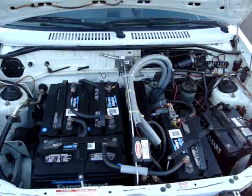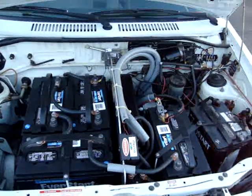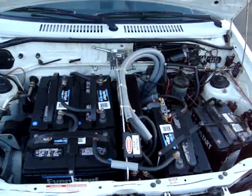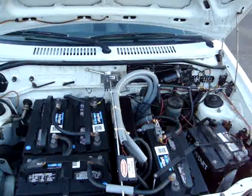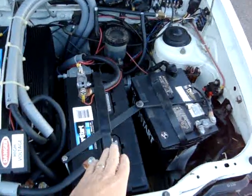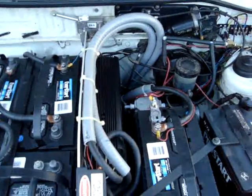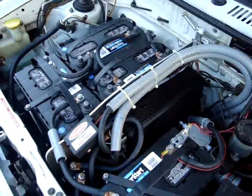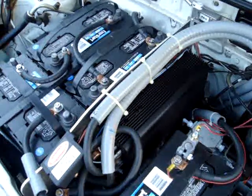Here's the view under the hood of the Ford Festiva. This is a 120-volt DC system, lead acid. He has four batteries under the front here and the auxiliary battery in the same place where it was originally — batteries one, two, three, and four. He has a heat sink mounted vertically, about in the center of the engine bay, and a controller here — looks like a Curtis 1231C, which would be a 500-amp unit.